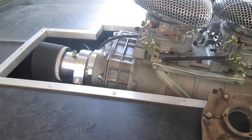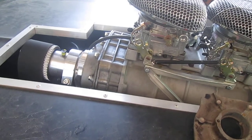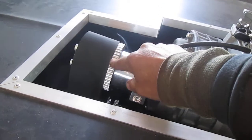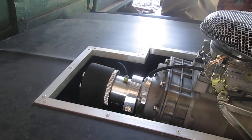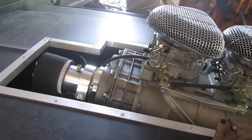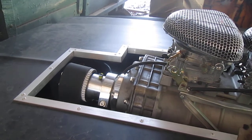On a street driven car like this we were shooting for like seven or eight pounds of boost. I ended up on like five and a half PSI on this one, but all you've got to do is drive it a little bit faster. I'm at ten percent over now — I probably need to call the blower drive shop and get a pulley configuration for maybe 20 percent over, which should shove me up to eight, eight and a half PSI.